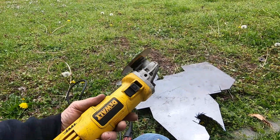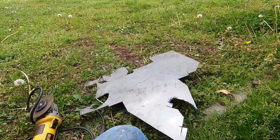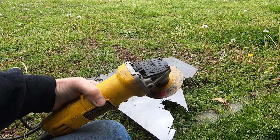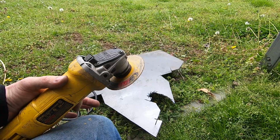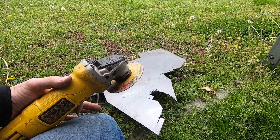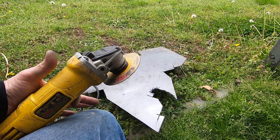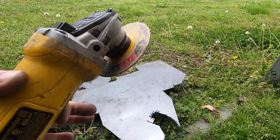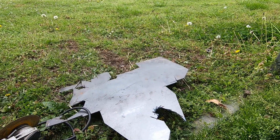And I used a cutoff wheel on a grinder and went around there. This is what I use when I do all my metal work, an electric grinder with a 4.5 inch cutoff wheel. I use the DeWalt cutoff wheels. They're .045. I think they have some .40s if I remember right. Anyway, I think they're called HP series, and you can see that red part on that deal right there. It means it's stainless and metal cutting. The HPs last a lot longer than the standard old cheapy cutoff wheels.